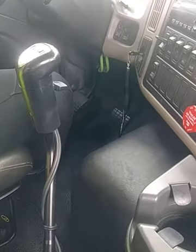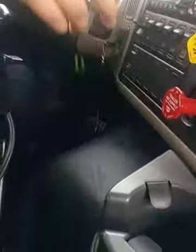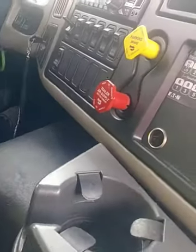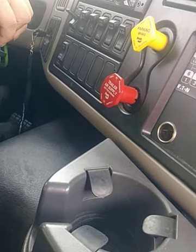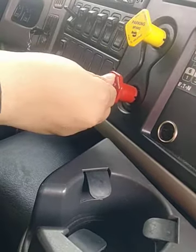For my first test I'm going to test my trailer brakes. Tell them you're going to do your tug test. To perform this I'll put my vehicle in low gear, release my service brake, and give it a slight tug. That's a good test. Now I'm going to test my tractor brakes — I'll apply my tractor brakes and release my trailer brakes.